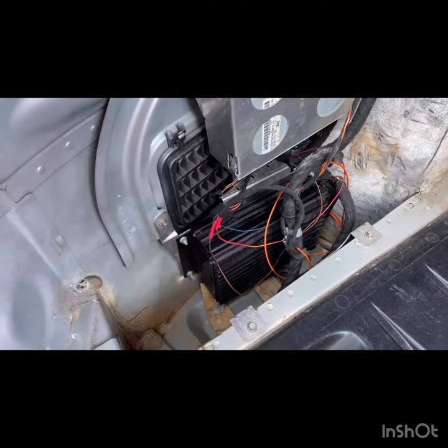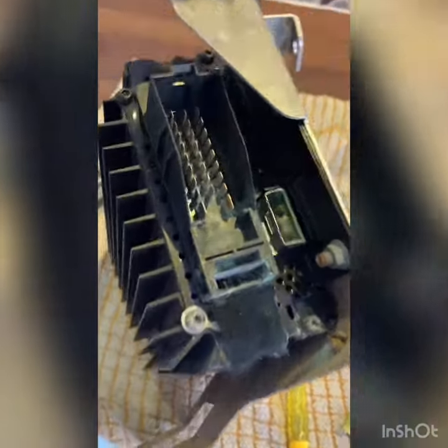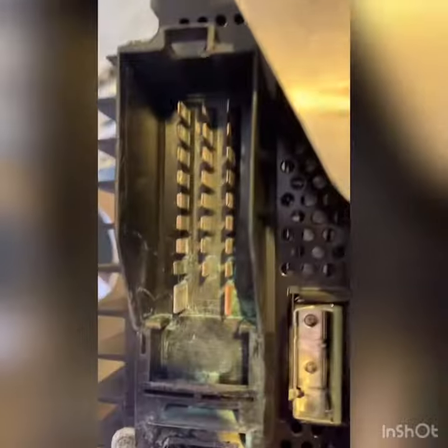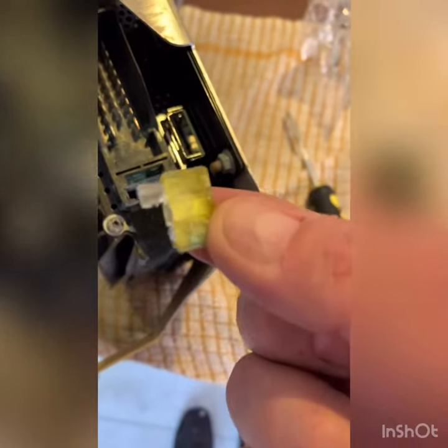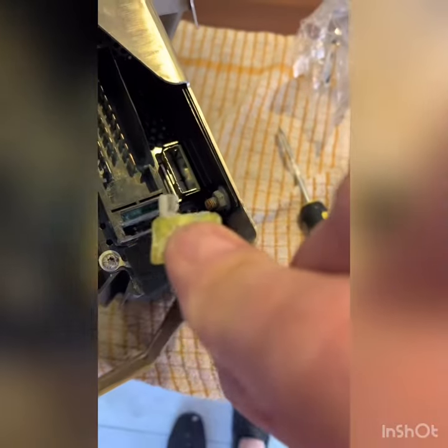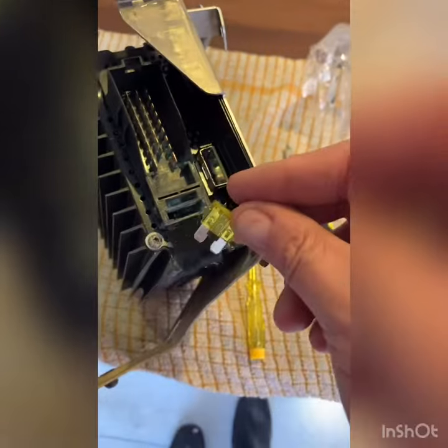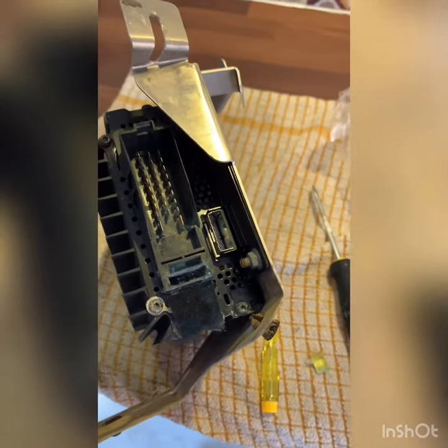On the radio in the CL55. As you can see, I've cleaned up the contact points a little bit, sanded them down slightly so we've got bare metal on the ends. What had happened is clearly water ingress, but as you can see, that 20 amp fuse is pretty much done for. So I'm going to replace that with a new one, plug it in again, and kick it up to see if it starts.